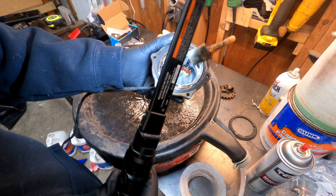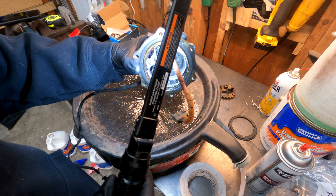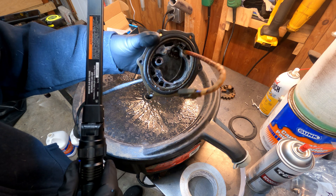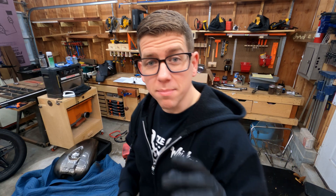Here's the other piece — same thing. It's definitely better, though these probably need to be dipped a second time. Now we move on to the tank, which had muriatic acid in it, which from what I hear should work better than the phosphoric. So if the phosphoric did that good, the muriatic should do even better.